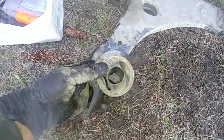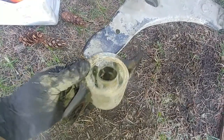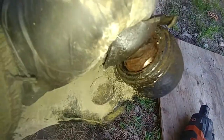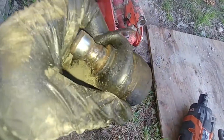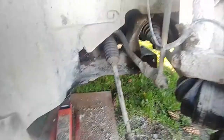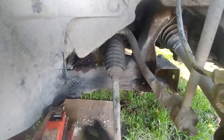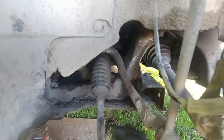There's a bushing — the new one will come with a new bushing. This bushing seems to still be okay, but on Fords you cannot separately replace the ball joint. The new one comes with rivets and a new control arm. The boot was torn, lots of dirt inside, dry with no grease, and it had play — time to replace. Do the cleanup and remove all dirt from the bottom of the engine subframe. Make sure everything is clean and ready for installation.